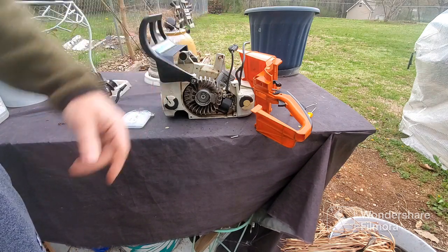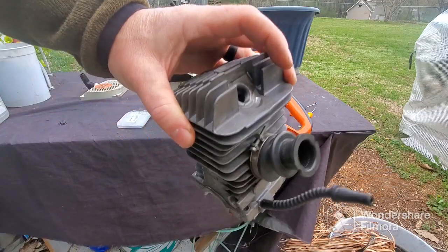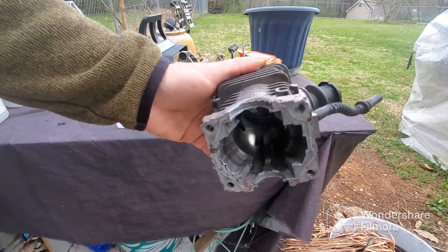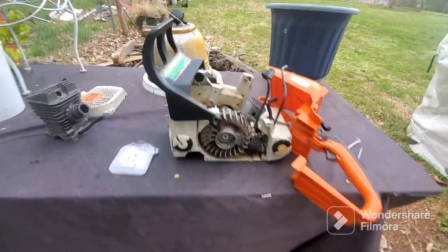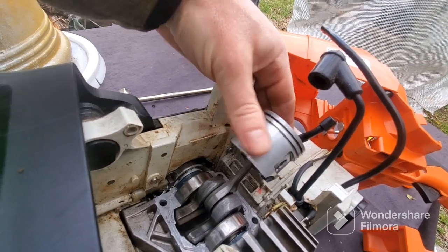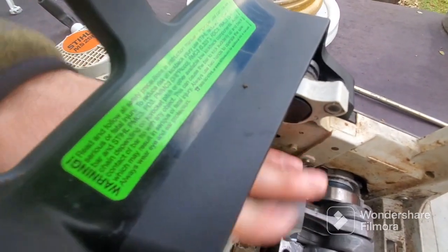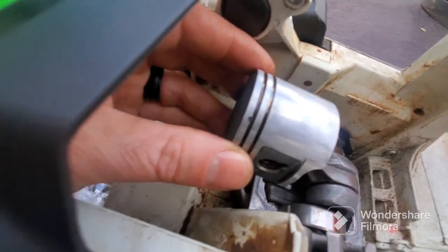Some of the things to look at: is the spark plug seated in the cylinder, is the spark plug hole stripped? This is a very nice cylinder — no spark plug stripping here, very clean inside. Look at how clean that cylinder is, no scoring. The top is dirty and needs to be cleaned, but even the back — no scoring. It's got some water on it so it might look like scoring, but the cylinder looks very good.